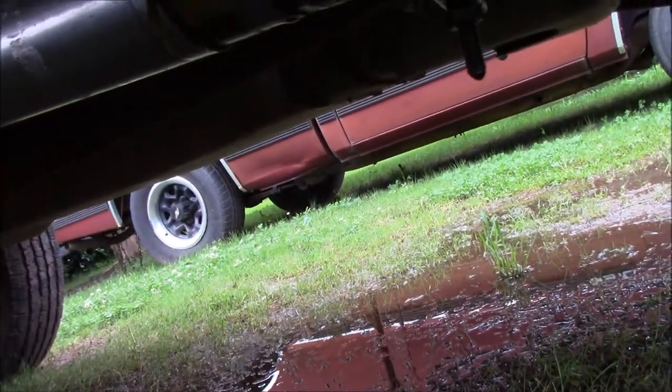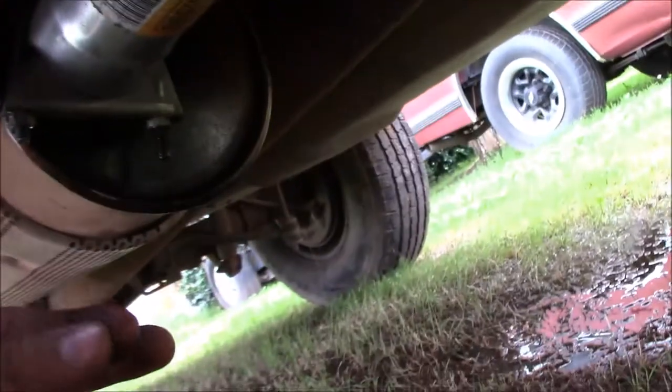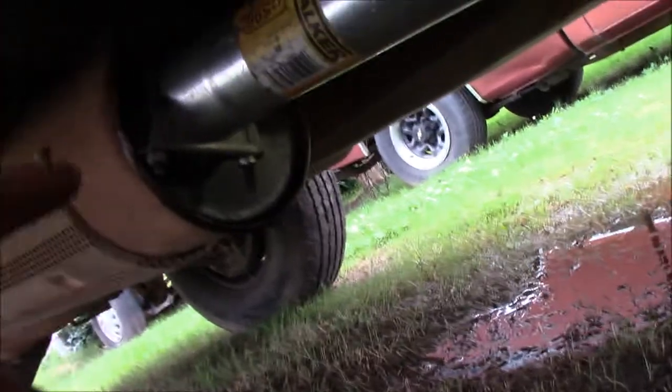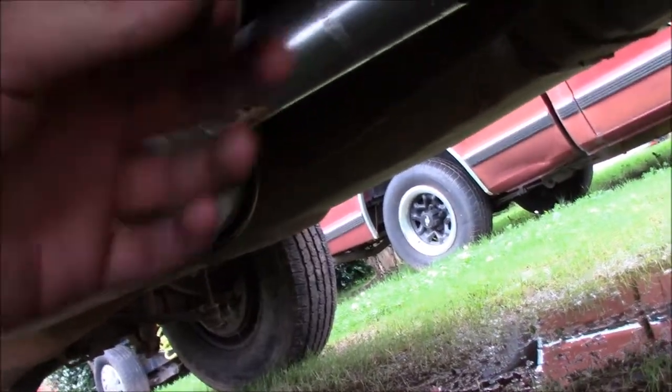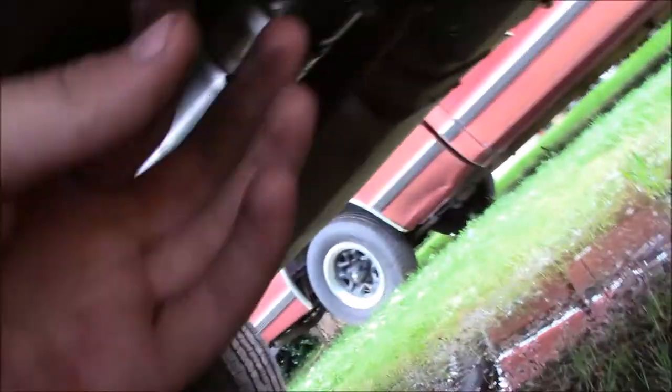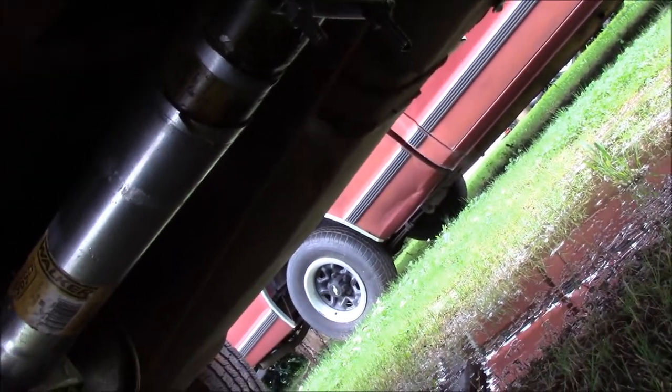If you look at this black, almost oil-like substance here, you can see it on my finger. At first glance, you would think that it was oil — same thing I thought it might be. But here's the issue: this is very grainy, and oil is not grainy. Also, my oil is not that color yet because this engine hasn't had oil in it long enough to become that dark. What this is, is carbon — solid carbon deposits that have broken down off the engine and are now coming out of the tailpipe and literally making everything dirty. There's a lot of it up there where those two pipes come in.